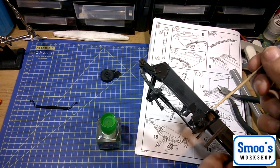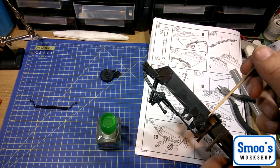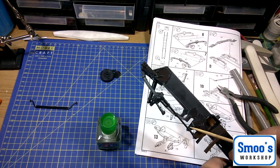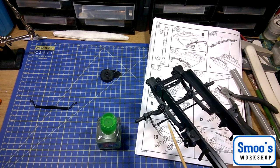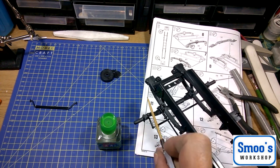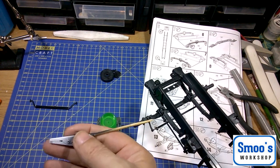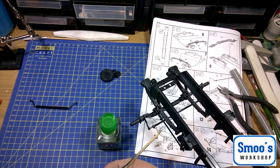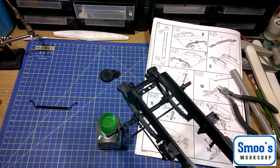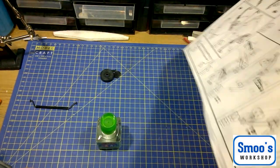So in theory, apart from this is slight like that, if you can imagine that this part comes down to the steering wheel, goes into that box, through a series of pinion gears, turns that lever back and forward, which moves that back and forward, yeah, onto this idler arm, which in turn pushes that or pulls that, which makes this go. The steering doesn't actually work on this. So when that's turning like that, that rod then pushes this one across and turns the other one the other way. A really simple steering setup. Then it goes on to, what's after that? I've got some more parts cut out.